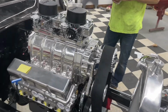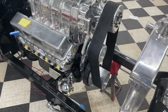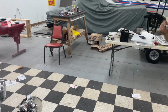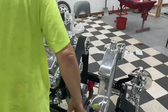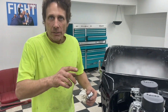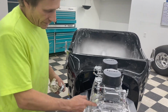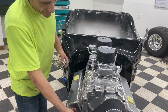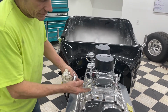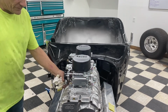Okay, so my fittings look like they fit. Oh yeah, I got all the fittings on. And here's what I want to do with just this particular one. I want to put 2 fuel filters on it. Here's what we're going to do: we're going to get a quarter T and put our fittings in. I'm going to put that right here with a 90 on this one. So we'll come up here with hard line to our T, and then I want to come off this way and that way. I want to put a filter here, and then I want to put a filter here.